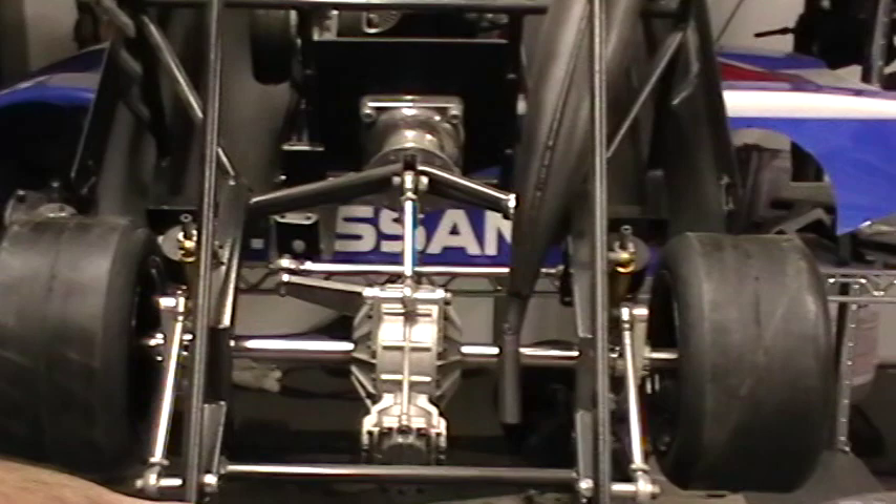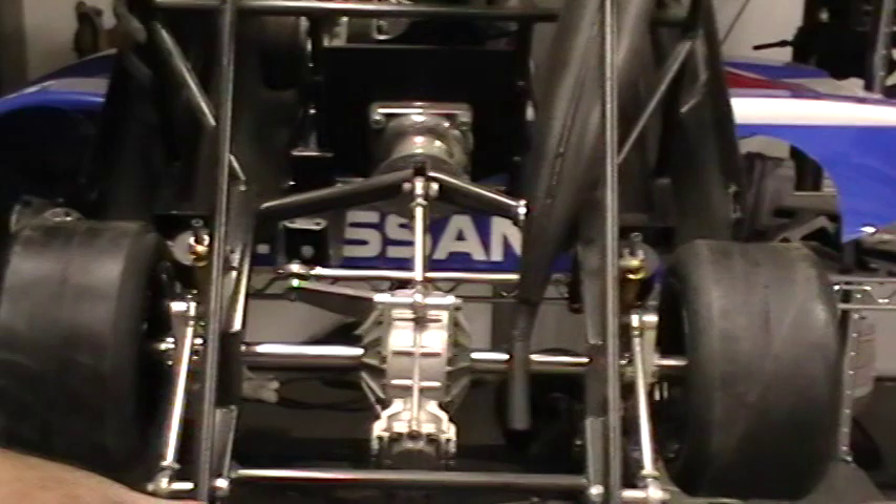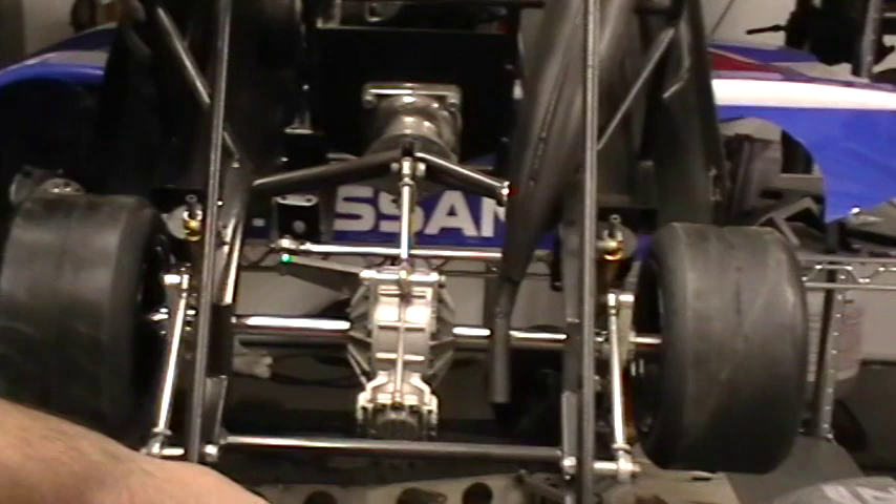Looking at the rear of the car, these cars housed a Skellinger quick change rear end. These rear ends were used in sprint cars, Grand Nationals, and such — generally higher end cars. The cover comes off and you can change out the gears for different gear ratios. It's got a ring and pinion — spiral bevel — just like a full size car does. An extremely scale rear end. You can also see back here there are no coilovers; it's just shock absorbers with separate springs. It also has a single disc brake. Just a very, very nice piece.